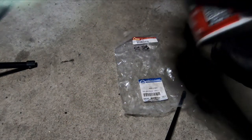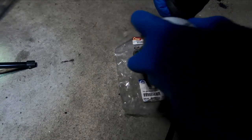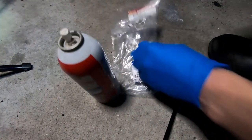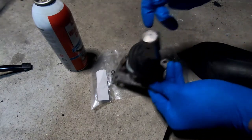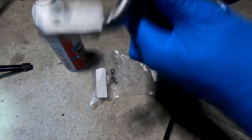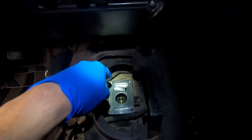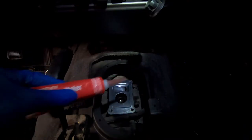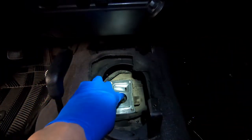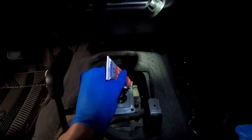I'm going to spray a little more white lithium grease on it to make sure the whole thing is lubricated, because once it's installed we're not going to take it out again until it fails. I'm keeping the bushing covered with a bag so it doesn't pick up any dirt. Then I'll put the rubber cover on. Before installing, clean the surface and apply red RTV to make a gasket around the perimeter — just make sure absolutely nothing gets inside the hole where the bushing goes, as it will cause transmission damage.